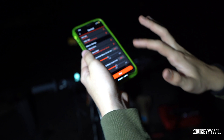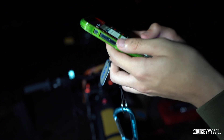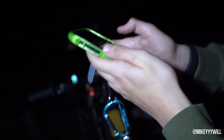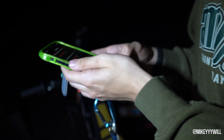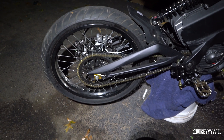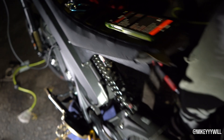Since it's automatically set up for 72 volt high-power harness I'm not going to touch that. The wheel diameter I'm going to leave as is — I feel like changing it too much might cause a crash. For the gear ratio there's a whole tip on how to calculate that. We calibrated and it said successfully calibrated, so that means everything is hooked up correctly. The last thing to do is check the motor direction.